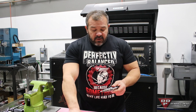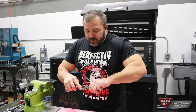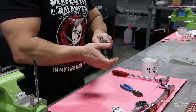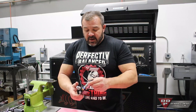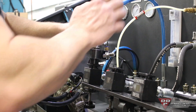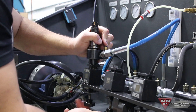If you're doing this at home, the only thing you've got left is to take the copper washer and install it. To make sure the copper washer doesn't fall off, take just a tiny bit of grease or transmission assembly lube and it'll kind of glue it onto the body. Here at the shop we throw it in the test stand — one of the values of in-house installation is we balance out your injector bodies so they'll run smoother than they've ever run before. Factory specs are a little loose; we tighten those up by a lot. We run the injector at five different settings and balance it to within about two percent.